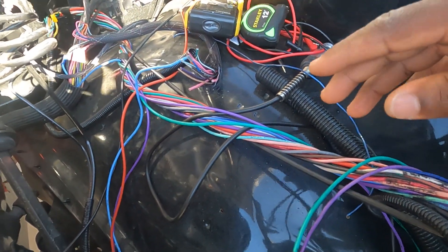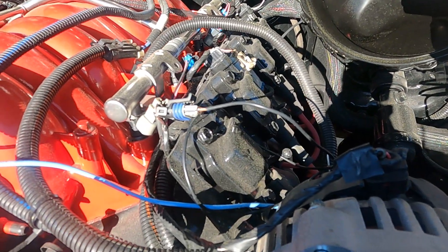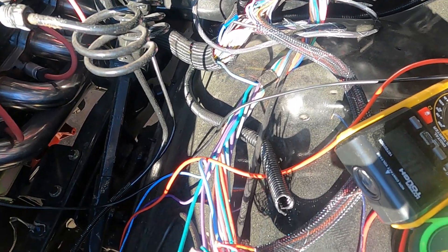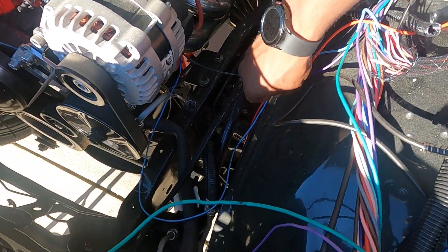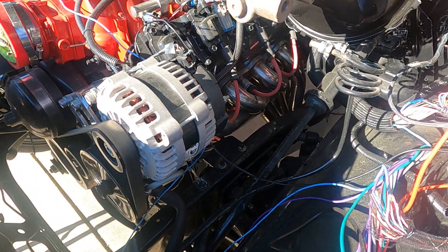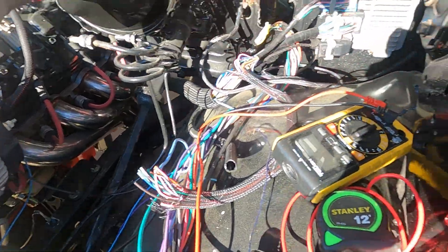Unless after they started it, somebody came behind and cut everything — I'm not sure what was going on. But I've got to connect these two pink wires; these are for my ignition coils. The way I found those wires: I put my voltmeter on the sound option so that you can find wires, then I touched the connector to all the wires until I got a noise. You've got one wire for one side of the bank and the other wire controls the other side of the bank.